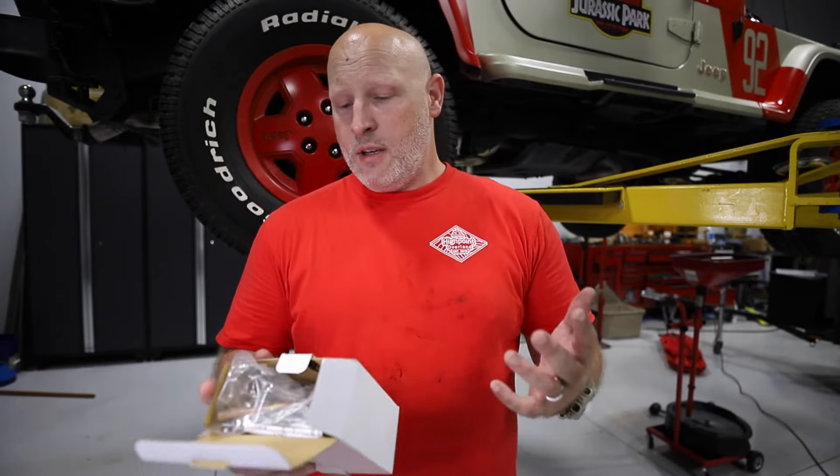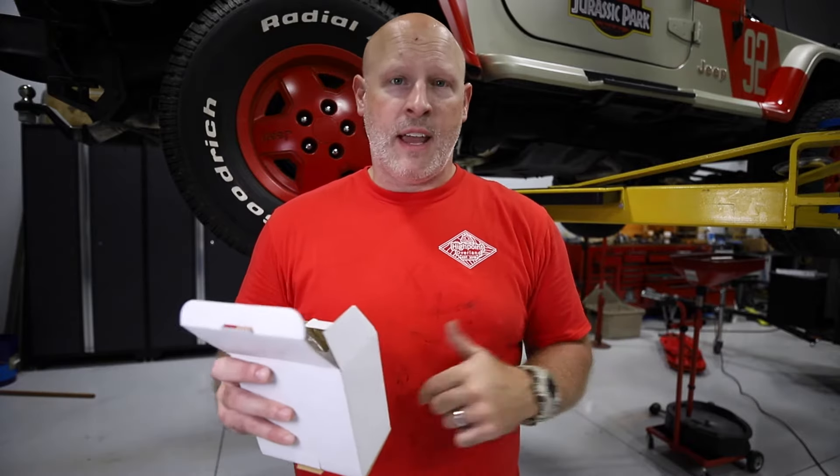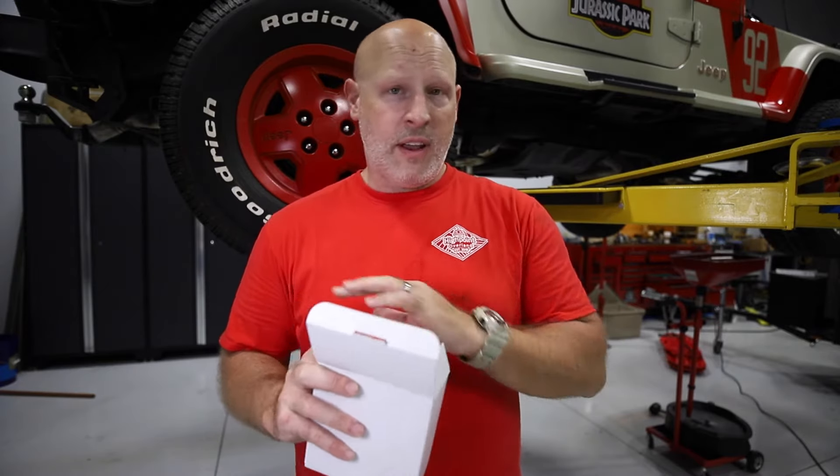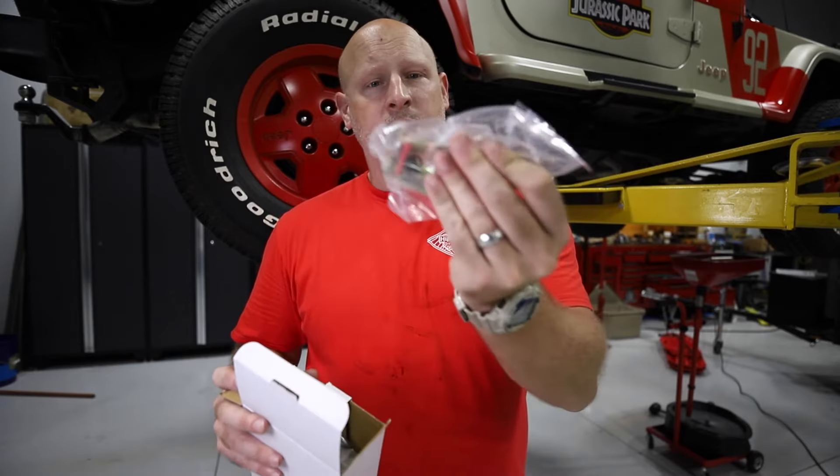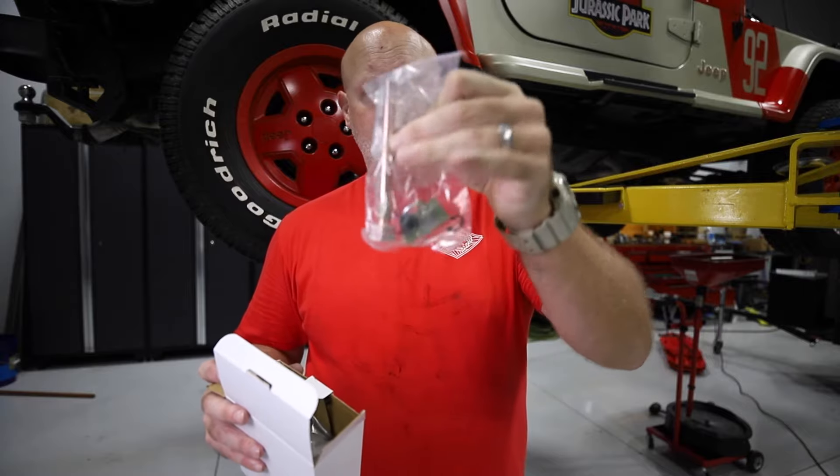Now that we've got the factory one apart and cleaned it up with a little bit of brake clean, we'll make it nice and clean for the new install. What we're putting in is the Rugged Ridge Permanent Diff Lock kit — I will link to that in the description below. They are not a part of this channel, so this is purely for your information. It comes with a new bolt, new c-clips, a new housing for the back, a new gasket, some zip ties, and instructions.